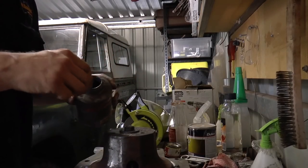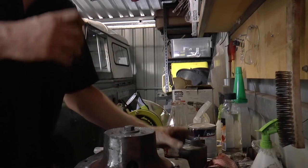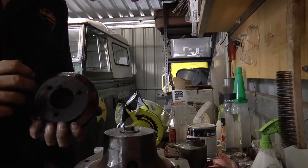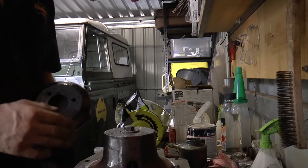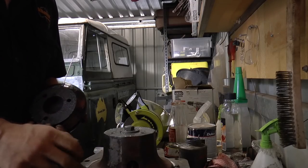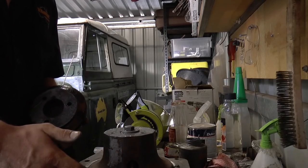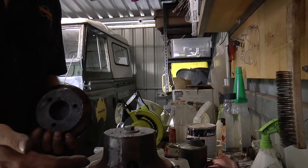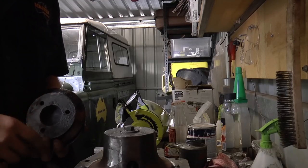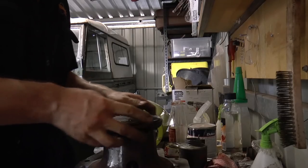Next thing I'll do is apply more anti-seize grease. The reason why I'm putting grease on this surface is that when I took it off there was a lot of corrosion in here. Over time it doesn't matter whether it's steel — particularly with steel and alloy — the alloy or aluminium will actually corrode quicker than the steel. This is because alloy generally has aluminium mixed in with it, and aluminium is vastly more reactive than steel. The more reactive of the two always reacts, and this is what we know as electrolysis. You particularly get this with alloy heads on cast iron blocks. So, we've got the top here and we'll place the top on.